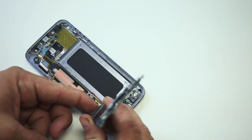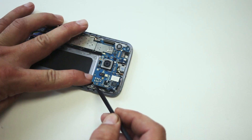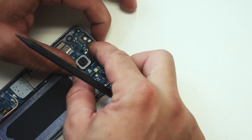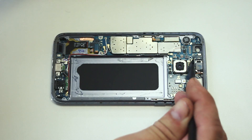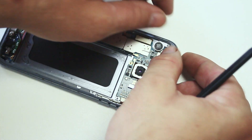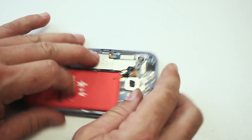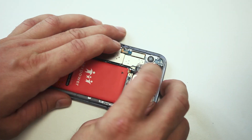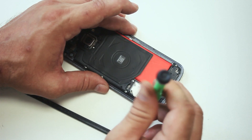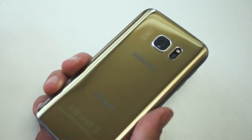Replace the motherboard. Pinch the one in the back, then slide the other connectors into position. Make sure none are bent under. Install the camera and the battery. Screw in the covers beginning from the bottom up for reassembly. Finally, replace the back cover. That's it. Thanks for watching.